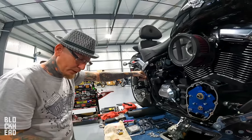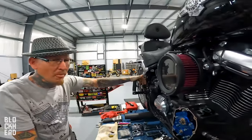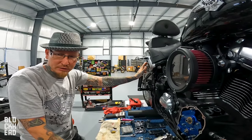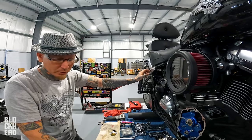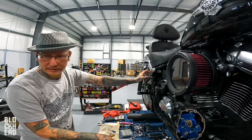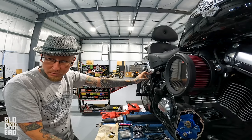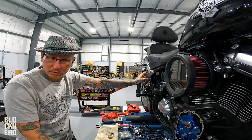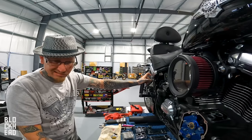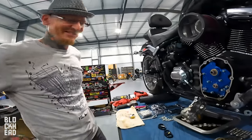They're all unique. In my experience, stock 114 is typically in the ballpark, again, it can be up or down depending on the engine, of 103 to 105 torque. Horsepower can be as low as 85, and I've seen as good as 89 on a stock 114. So if you take those numbers and extend that horsepower from, say, 90 to 119, what are we looking at there? Oh, 20 or 30 horsepower? Increase in torque, pretty equal, I would say. So if you got as high as 130 coming out of anywhere between 100 and 105, whatever that percentage is, there you go. All right, mathematicians, get on it.